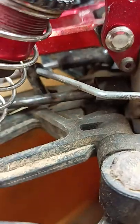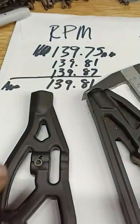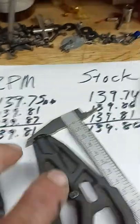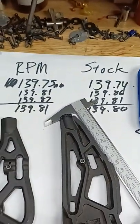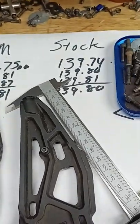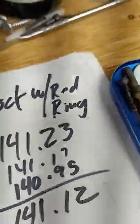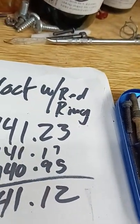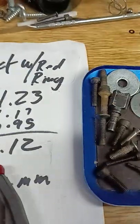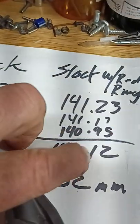It's usually the passenger side — same deal on my Outcast, but that one hasn't been out because I fixed the problem. Here's the problem: this RPM swing arm measures out under 39.8 — measured three times. Here's the stock one — they're the same exact length. People say it's because they're flexible, but here's the real problem: this red ring they put on. When you have the red ring on there, they measure out longer.